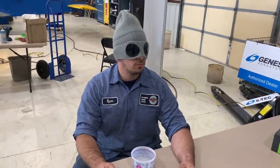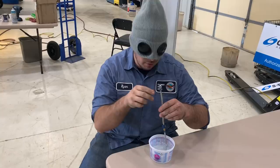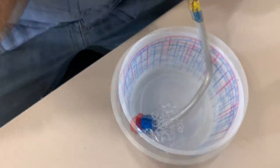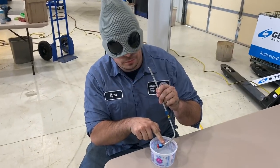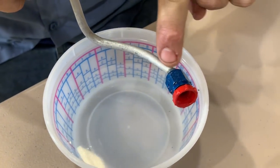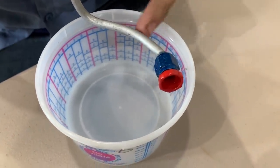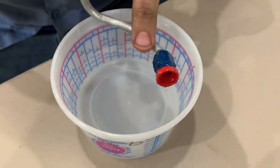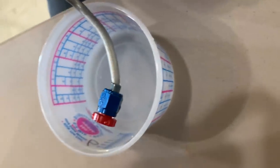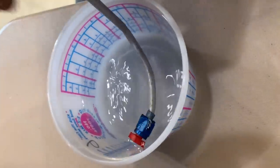What's the mask for? To protect my identity. This is the brake line that's leaking — as you can see, we do a calibrated test. It's leaking from this bottom piece right here because it got pinched right here. If we go over there and look at the floorboard, you'll see why — the floorboard is sagging, hitting the top of this line, and it causes it to chafe on the backside of the sleeve, leading to it leaking.